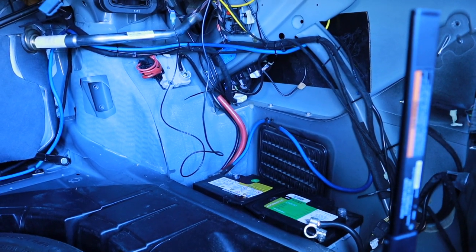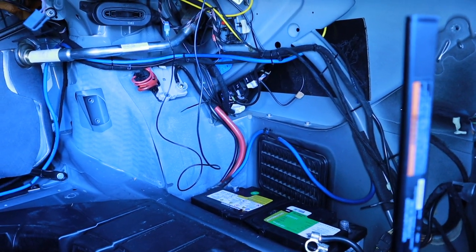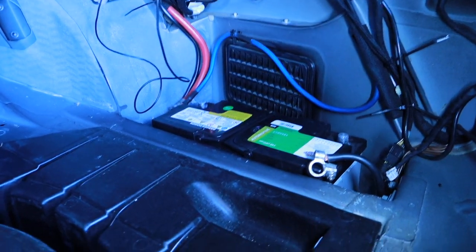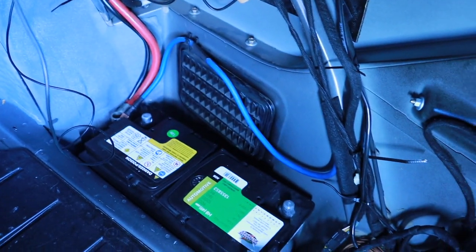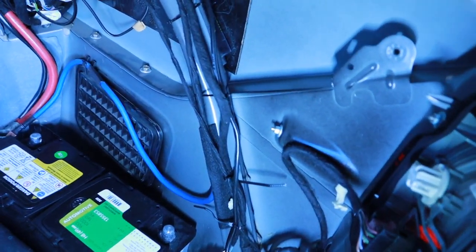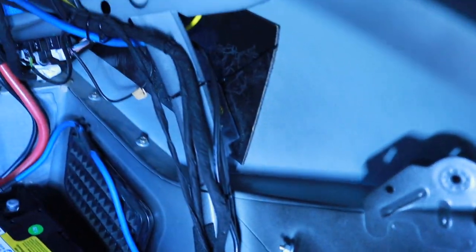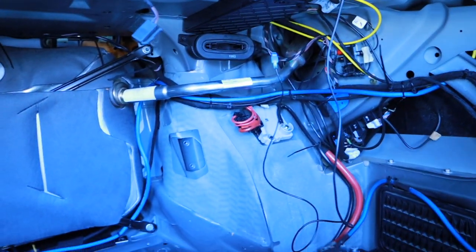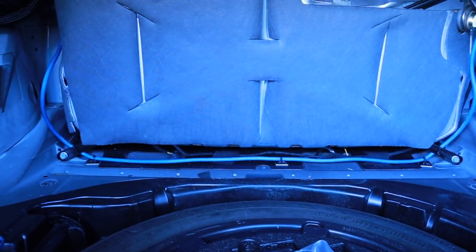All right, so finally got the interior done, wrapped up. What we're doing now is getting the amp. The amp's been working, just trying to clean it up. So just trying to document here. So there's my 4-gauge, the blue wire is the 4-gauge power for the amp. Run around, there's actually back here, this is a Stinger kit. Back here is actually the kit there. Run through there. Running the blue line down through there. Don't know if it's a good idea or not, but that's the power.